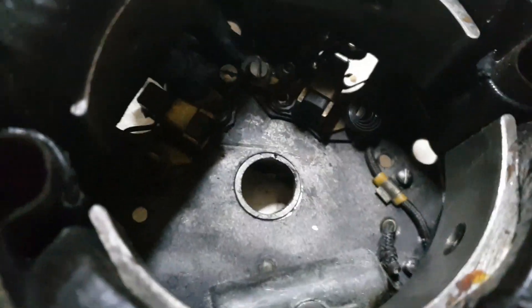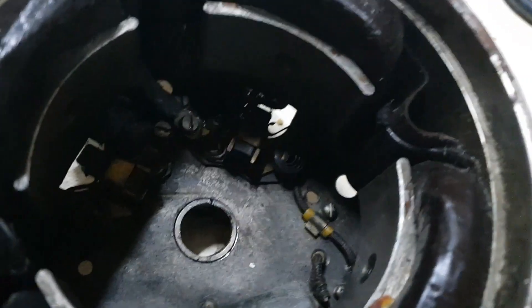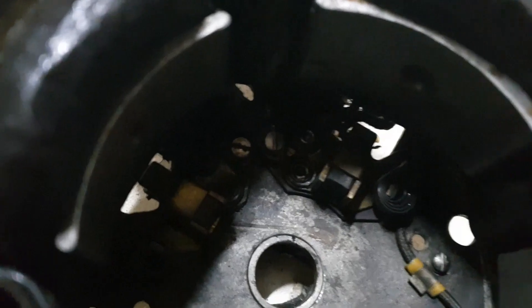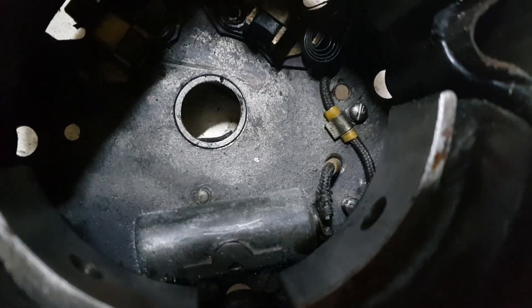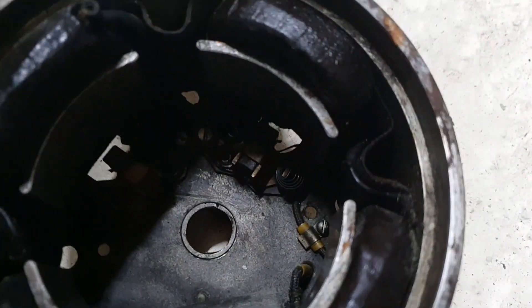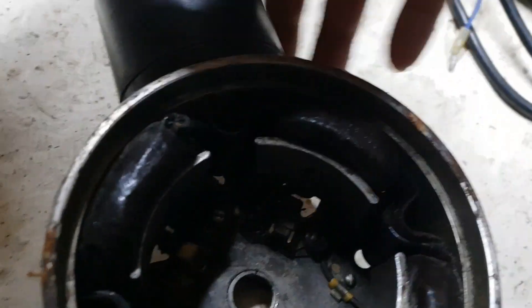Here's inside the generator — you can see down there. I folded the springs over just to get it in, so once they're in we can push the carbon blocks down and then clip the spring in on top, which should keep them tight. There's the old capacitor in there — I haven't checked that yet or fiddled with it, so we'll just try and see what happens, see if it sparks too much. If it does, we'll swap it over and get a new condenser.